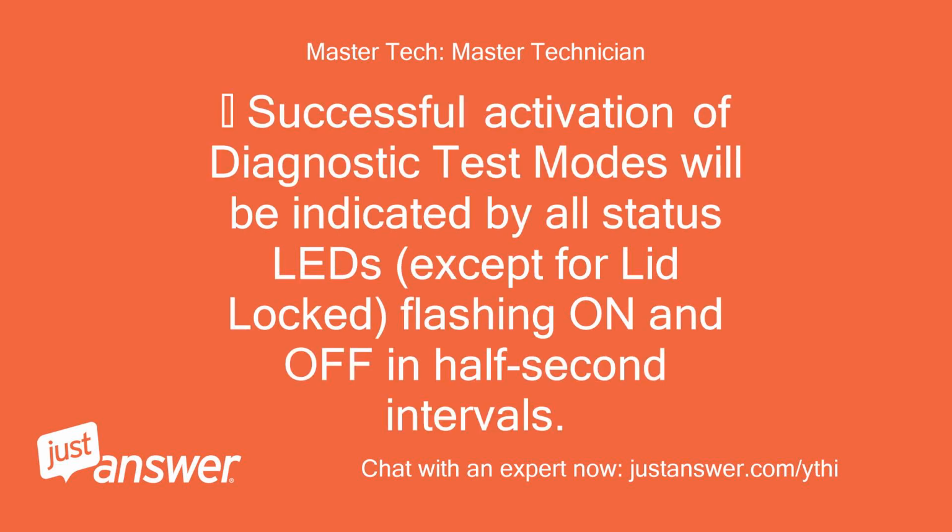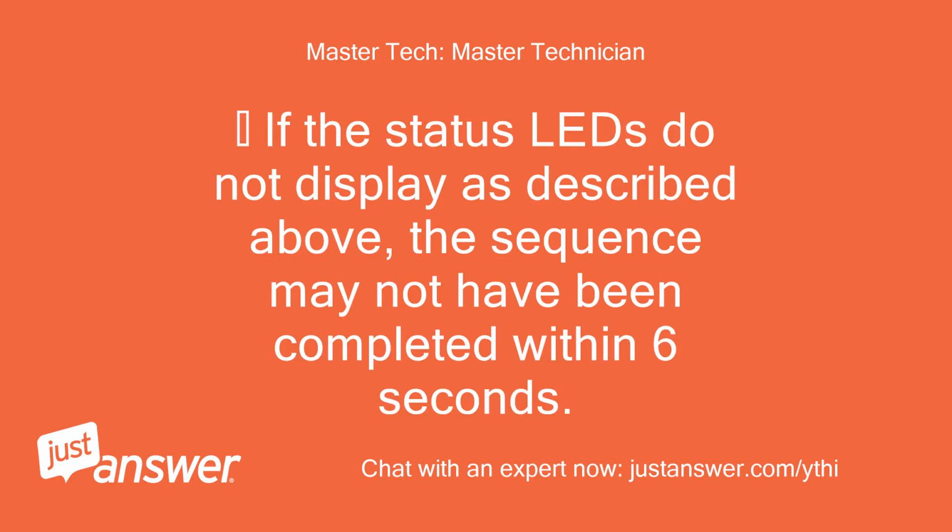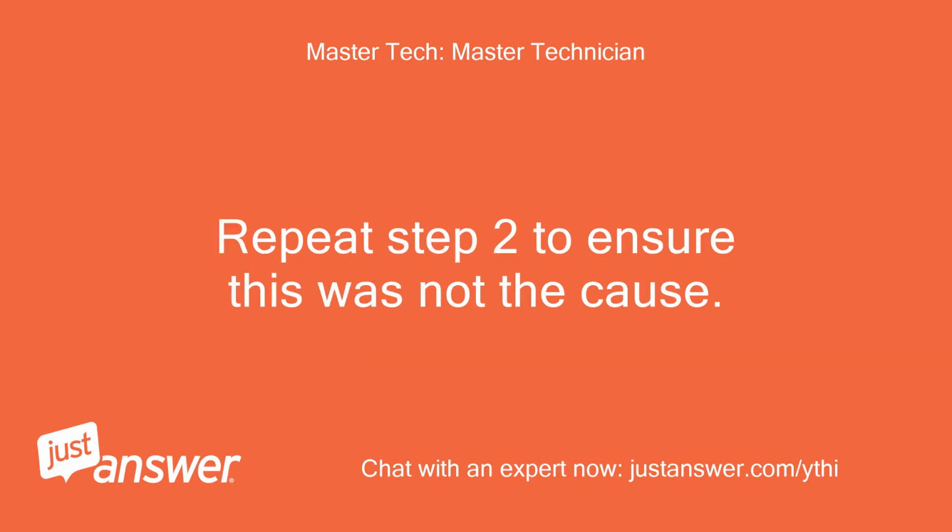Successful activation of diagnostic test modes will be indicated by all status LEDs, except for lid locked, flashing on and off in half-second intervals. Note: LED names may vary between makes and models. If the status LEDs do not display as described above, the sequence may not have been completed within 6 seconds. Repeat step 2 to ensure this was not the cause.